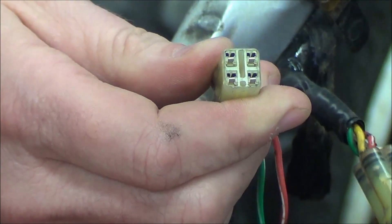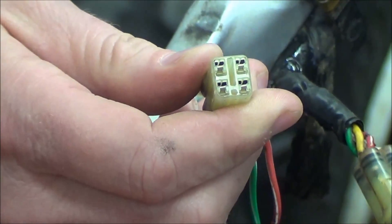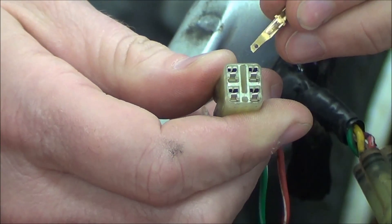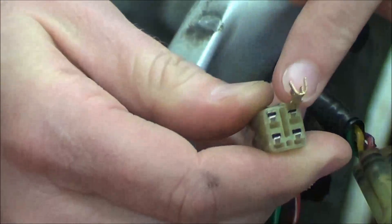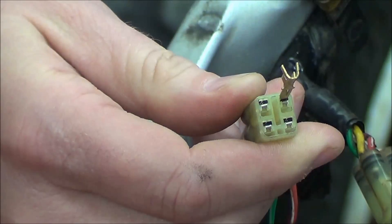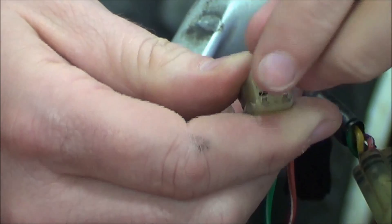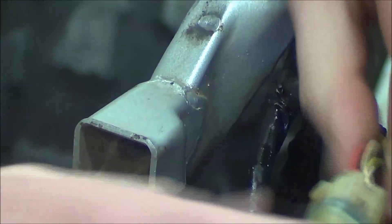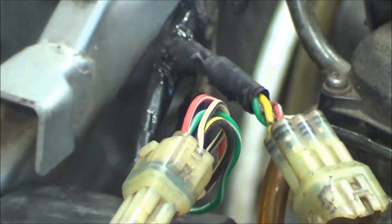We basically just have a small male pin that we ground down that has no resistance. You can put a small male in there. And then from there we could grab our multimeter and get good testing results. But this only means that we could test from the outside back to the component. If we really wanted to test live voltages as it's installed, you can see why we have to be able to back probe. So that's that tool.